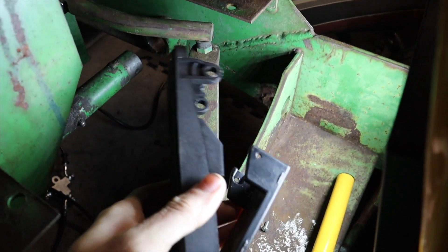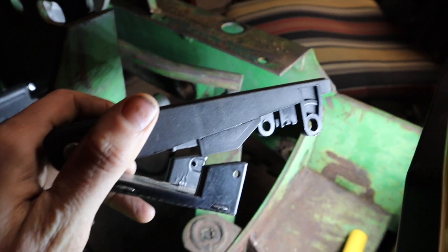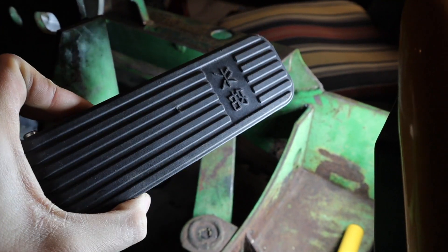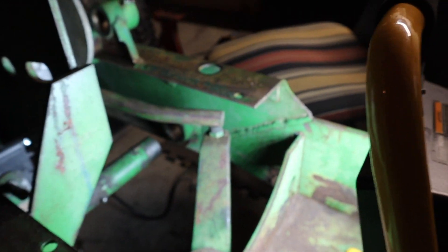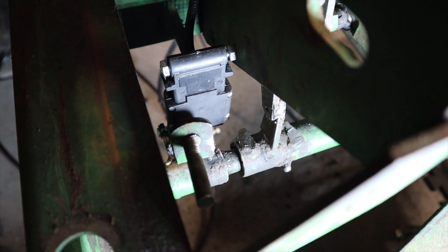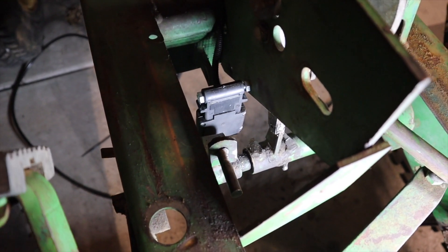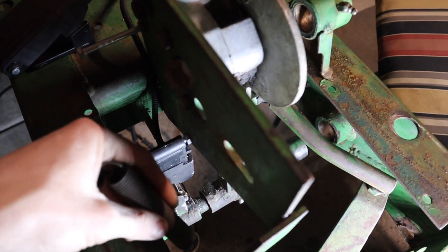I want to show how I did the throttle. It came with this foot pedal — well, I purchased this universal foot pedal, and I'll leave links in the description to these parts; you can even get them on Amazon or Alibaba. It connects to the controller quite nicely, but I didn't want this plastic foot pedal to throw off the look of the original tractor, so I kept the original foot pedal and took off the little actuator that was used to variate the speed of the motor. As I press the throttle down, that compresses the little actuator to variate the speed.